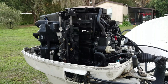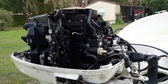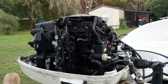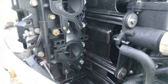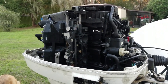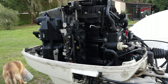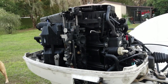They probably rebuilt them not that long ago but just didn't do a very good job. I didn't find any water, but I did find a good bit of oil. Usually what that means is the engine's been sitting a while. You said only a few months, and this usually wouldn't happen in a few months, but if it sits six months to a year, the gasoline evaporates and leaves the two-cycle oil behind. That by itself can gum up the ports — for instance the idle ports, which are two tiny tiny little jets responsible for keeping the engine at idle. There are two circuits: an idle circuit and a throttle circuit. The idle circuit is solely responsible for keeping the motor running and its tiny jets can get clogged with anything, oil included. That's what I found so far.